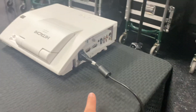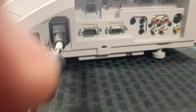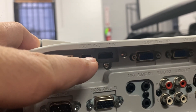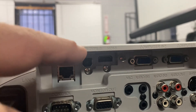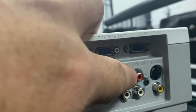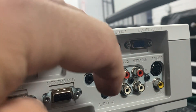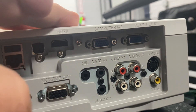A little trick: what I would always do is hook everything up — the computer and everything. You'll see this is where the plugs go. That little plug right there where I'm pointing my finger, it says HDMI. That's the universal cord — you would plug in there. Now, if you are doing audio for a slideshow, you could come out of the audio out, the RCA plug, which is red and white. You would take that and plug it into the back of your mixer.